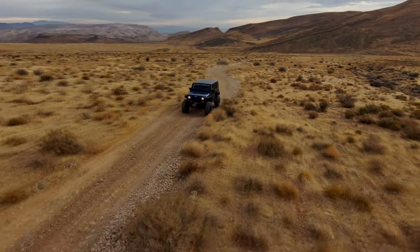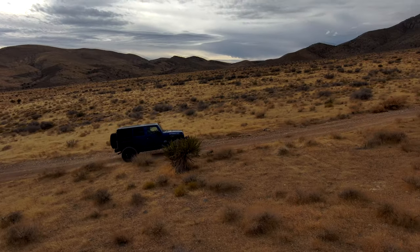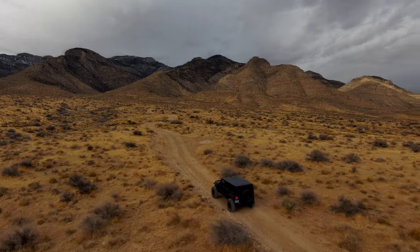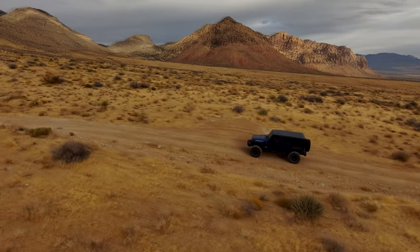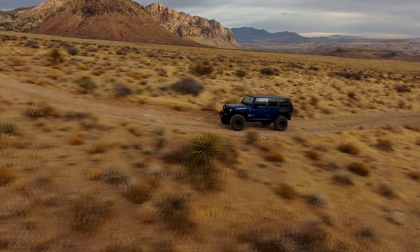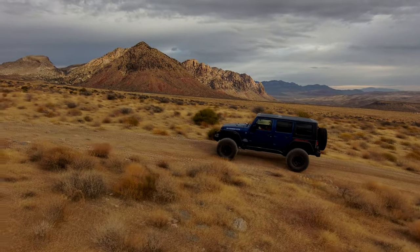So this was the second vehicle that I did. This vehicle got a 2009 L9H, because that's what was out at the time, with a 6L80. And 2009 was somewhat of a unique year, because in 2007 and 2008, the L92 was a great motor, but GM was still learning a lot, just like they are with the early LTs in 14, 15. And in 09, they really cleaned everything up. They pretty much standardized the hardware. They went to a different oil pressure sensor. They went to flex fuel with larger injectors. They changed the intake. But they still had a go-between operating system in 09.